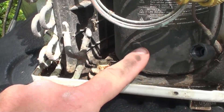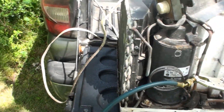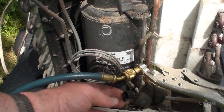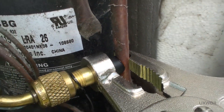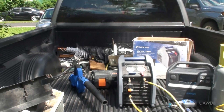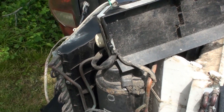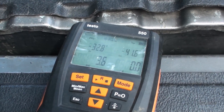And if we look here, I think this is a blowout plug on the body of the compressor, in case the pressure gets too high and nothing else will stop it. When something else in the refrigeration circuit doesn't fail first, this will. We should have brought the IR camera out today. Looks like maybe it's leaking a little bit — there's some oil around there. I'll let this go into a slight vacuum and then shut it down. When I shut it down, the pressure will probably come back up, because there's refrigerant that's trapped in the oil here, and it'll start to rise out as vapor and enter the rest of the system. So it may take a few tries to get all of this refrigerant out.